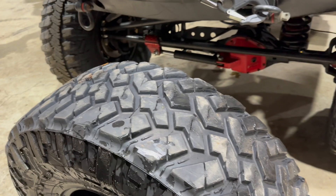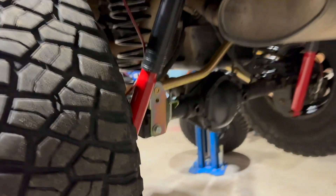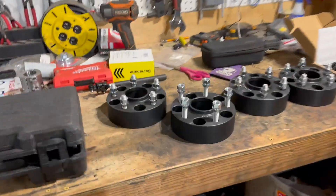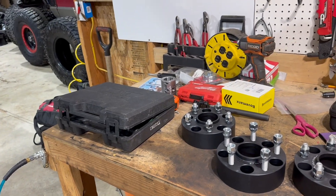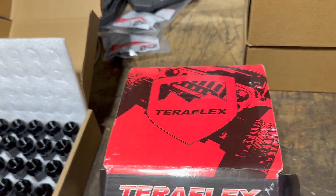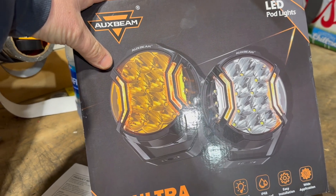Going from the 39s to 37s should help with clearance. The 39s are a little big and I have to run like three inches of bump stop, so with the 37s I'm hoping to get down to just one inch of bump stop. I also ordered a set of two-inch wheel spacers — I know a lot of people don't like them, but if you think they're unsafe, go look at any dually; that's exactly what the front end has. Steven runs two inches on his with the same offset wheels and it works great. I ordered black lug nuts to match and some Teraflex ball joints.